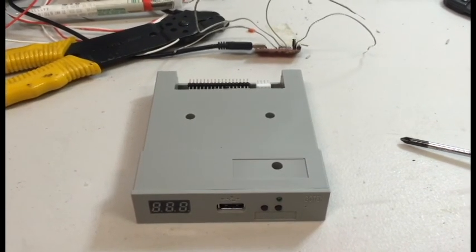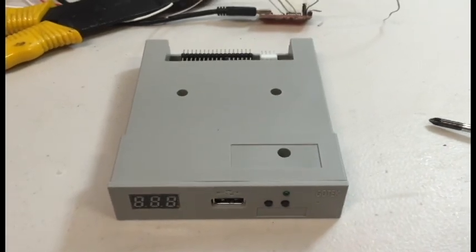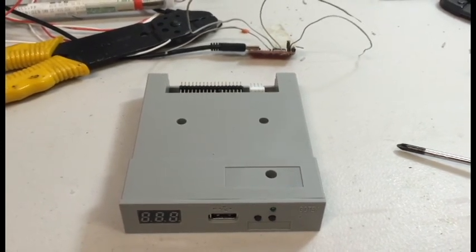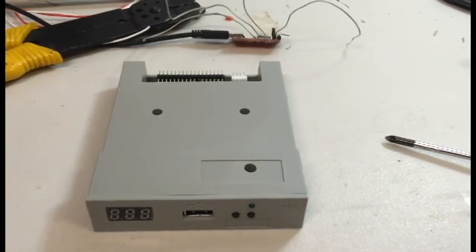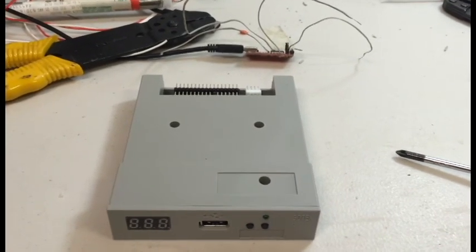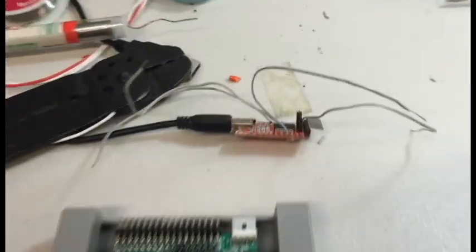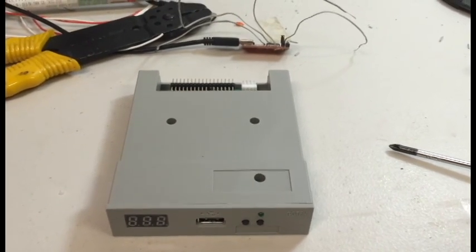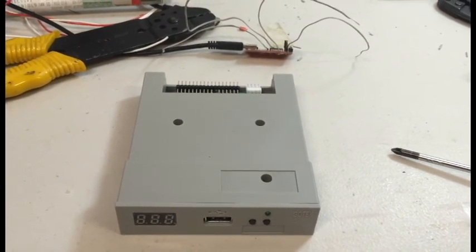You're going to get a better product by getting an HXC — there's a lot more you can do with it. But for $18, which is what I paid for this GoTek on eBay, as long as you know what you're doing when it comes to flashing it, you are allowed to install an HXC bootloader to essentially turn it into an HXC for a cheaper price. It's great because if you have a system that requires multiple floppy disk drives, like a PC-98, in my case I have two — you're looking at maybe $36 plus maybe $2 for a programmer versus somewhere in the neighborhood of $60 to $80 plus shipping for an HXC for just one. This is a lot more affordable, especially for my hobbies.